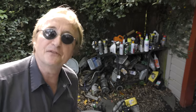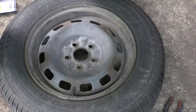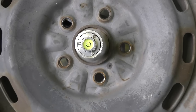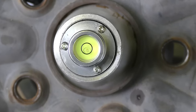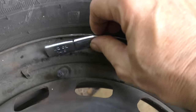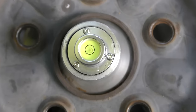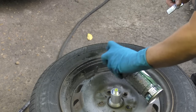But I'm going to take the weight off and show you how you would balance it yourself. Take it off and put the tire back on the balancer, and as you can see now the bubble is off-center. So we need to put weights on to make it go in the center and balance the tire. You move the weights around until the bubble goes into the middle, and of course in this case the old weight was here, so if we put it in the same position, the bubble is now in the middle. Then get some good cleaner to clean it up well.